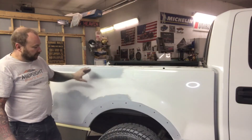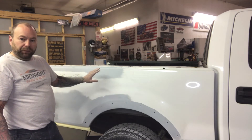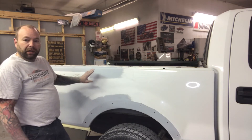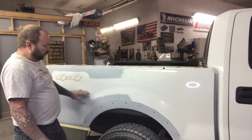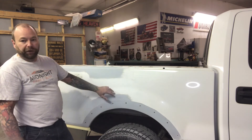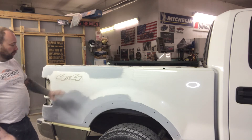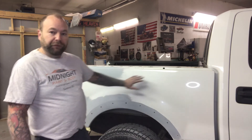So I machine-sanded the rest of the primer with 320 grit on the orbital sander. Earlier I mentioned the 100 grit rule and I just realized I didn't really clarify that. What that means is when you're prepping and doing bodywork, you always want to stay within 100 grit of the last paper you used. So if you're using a 240 or 220 grit to start, you don't want to jump right to a 400 because that's not going to take out those scratches. If you go from 220 to 320 and then to 400, you're going to get that fine finish you need for paint. So at this point I have machine-sanded all of this, and the next step is to hand-sand with 400 the rest of the panel. The front of the panel I'm going to finish with 800, and I'll explain that once we're in the paint booth.